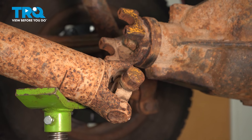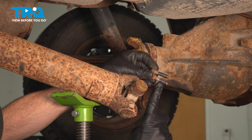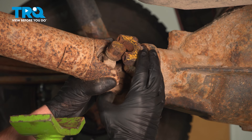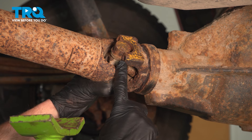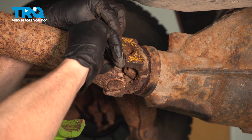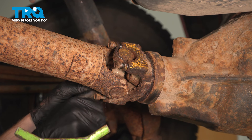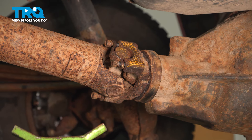Let's get the tape off of here. Before we install the driveshaft into the rear differential yoke, it's important to make sure you clean up the threads of your mounting bolts, apply a thin amount of blue thread locker — never red thread locker — and clean the inside of each one of your caps. Let's start bringing this into position, paying attention to your caps so they don't fall out of place. Press it right into that rear differential yoke. Don't let go until you start in each one of your two caps, otherwise this could potentially fall and hurt you. We'll start these in, snug them up, and torque them to 18 foot-pounds.